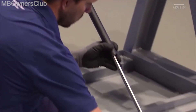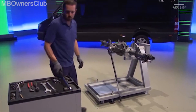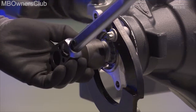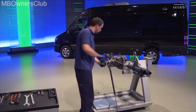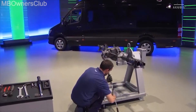Once again, support the holding device with a suitable tool. Now use a torque wrench. Tighten the collar nut to 200 Nm. Then you can remove the holding wrench again.